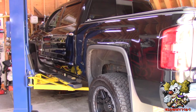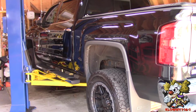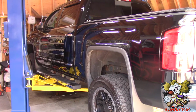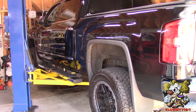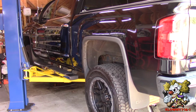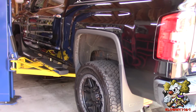Welcome back, guys. In this video I'll be installing a lift block kit in the back of this GMC. This kit is a Mammoth 4x4 kit, part number S108531, and it's for 1999-2017 GM 1500 body styles. It's a 3-inch block kit that installs between the axle and the leaf springs.